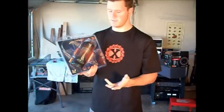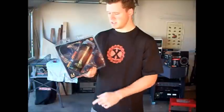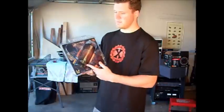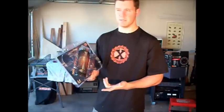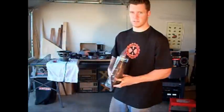The 2.4 farad capacitor should be good for 2,400 watts, which is what the amp is rated at. But we saw by the spec sheet it's a little bit less. This should allow a little bit better performance when the bass hits — it will stop the voltage from dropping as much. The better way to go if you're going to spend a little more money is to get a Stinger or a Kinetic battery. They're like having 100 times 1 farad caps — they call them the cap killer. It's another good product, but we're going to use this one for this particular unit.